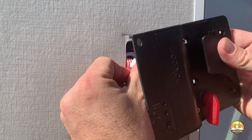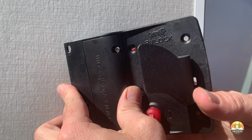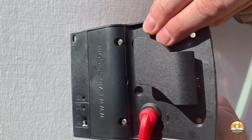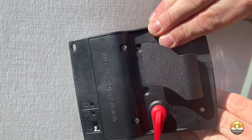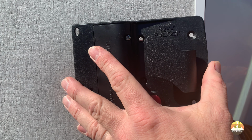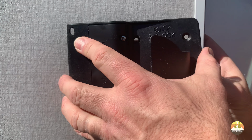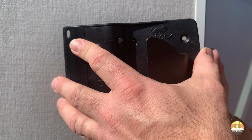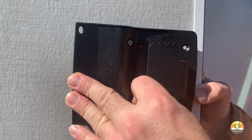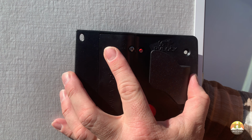Once you've tucked the wire harness into the existing opening of the door, begin to align the interior deadbolt and the interior lock release handle with the 2 components on the front half of the RV lock. This may take some finicking around with each of these to make sure that they align right. And essentially, for both of these, there's only one way that these 2 can line up together and work properly.